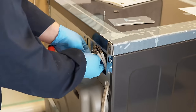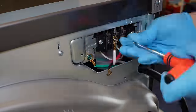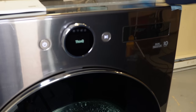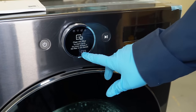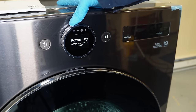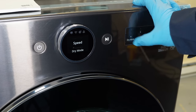Unlike the other heat pump systems we've discussed on the channel, this one does require a 220 volt outlet in the American version. Pay attention to that when installing this, and use a strain relief for the longest life of the terminal block. Once you have that done, on boot up you'll get the request to use the LG ThinQ app and also to clean the filter after every load. The unit has about 10 different drying features on boot up, including normal, bedding, AI, and power dry, among others. You can add multiple other modes through the option menu as well.